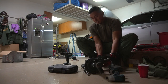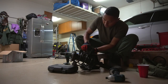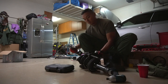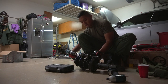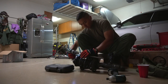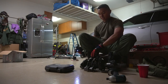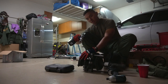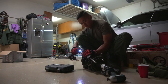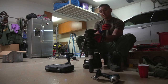So it grabs. As you can see right here, I already have one side on, but we're doing this here for you guys. Pushing the pin. Now it ain't going anywhere. Tighten this bad boy up. Do little by little on either side. Don't go all the way on one side, otherwise it'll bow. And as you can see, now this freely spins. That means you've done it enough.